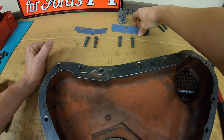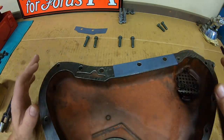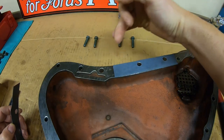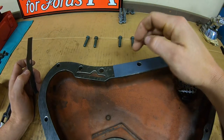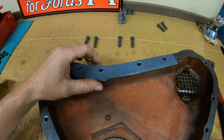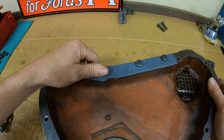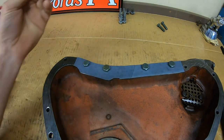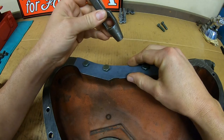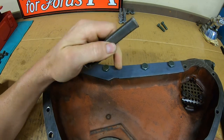Another request was to show how I make jointed splices in multi-piece gaskets. When making your own gaskets, you'll often encounter a situation where one sheet won't do the entire gasket in one piece. What you do is make your gasket for however long your material affords you, and I like to put the splice joints between bolt holes, because having a bolt on each side of that splice is going to help hold it together. Make it so it overlaps a bit — we're overlapped by about an inch right there. Drop some bolts in to hold that into position. What I do is called the doll-head joint — it looks like a puzzle-piece joint, rounded and kind of tapered on each bottom edge.